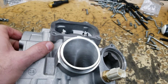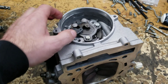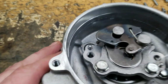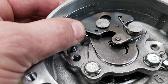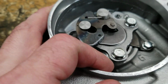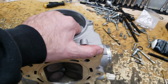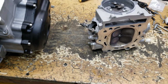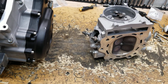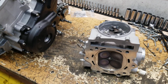A lot of guys go extreme on this inlet area, cutting this real thin. That is counterintuitive. But either way, you can see here there's some discoloration on this decompression. That is because we actually weld those together. These areas right here are factory rivets that sometimes break. So we weld that to not have failure. So these head packages are all inclusive in cam, porting, valve springs, hardware. We use factory seals in them and make a bunch of power. So that head package works up to just under 100 horsepower. Haven't quite broke 100 on one of them yet, but very, very close.